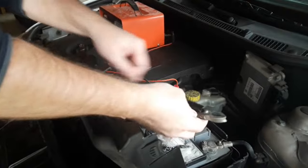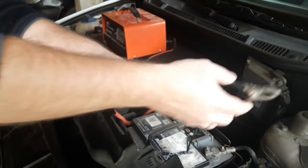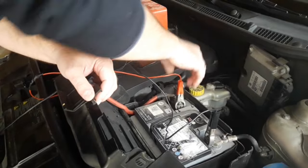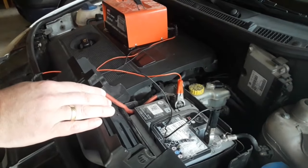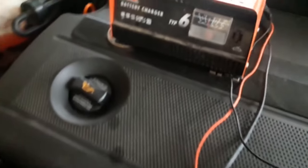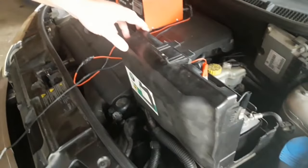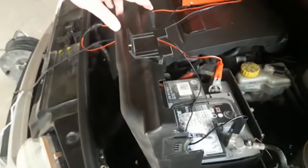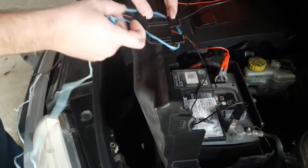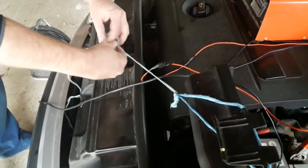Make sure that the charger clamps are snug on the battery terminals — if not, the charging will be weaker and they can accidentally snap off while under voltage. Pay attention when doing this, as if you switch the clamps there is a good possibility you can damage the car's electrics and electronics, and the fuse on the charger may blow. Best first connect the clamps and then the power supply. If possible, put the plus clamp first and minus clamp second. Position them so there is no danger of accidentally touching other parts of the car. If you have a plastic cover over the battery, make sure to either remove it or secure it so it doesn't fall back on the clamps.